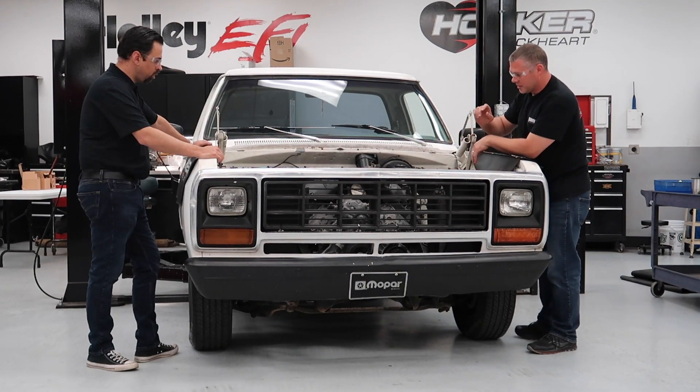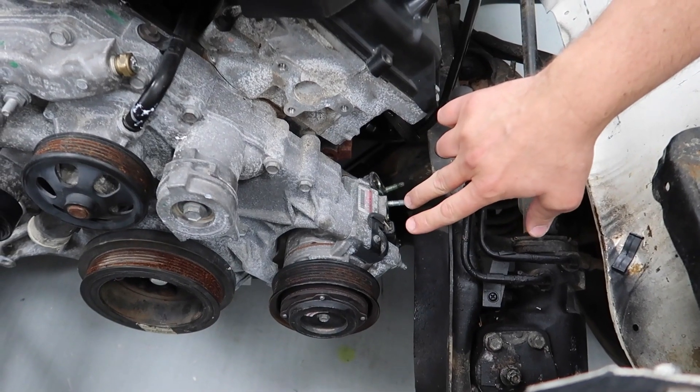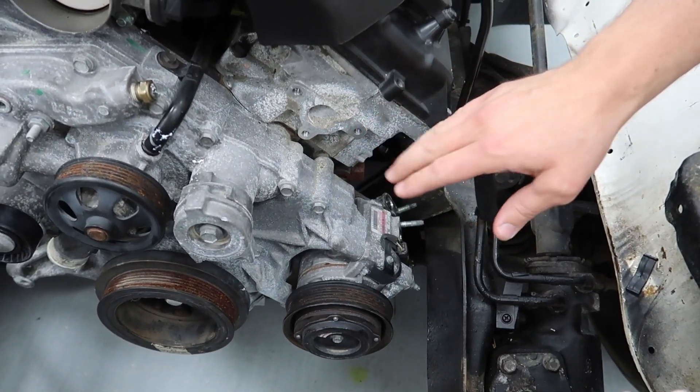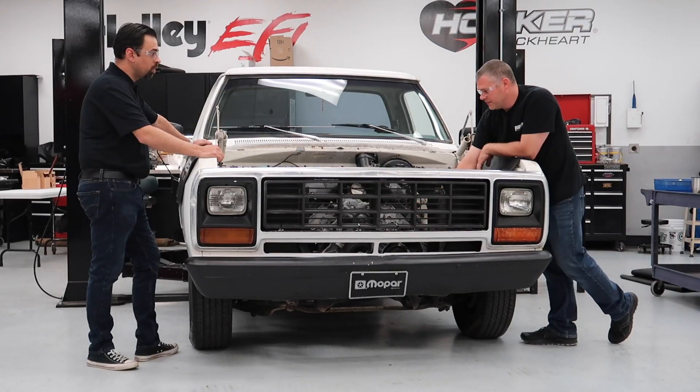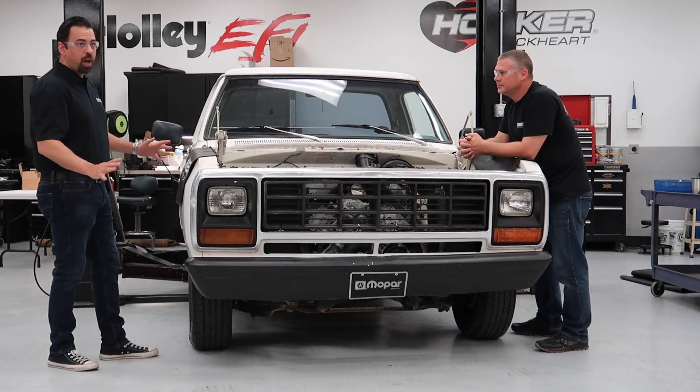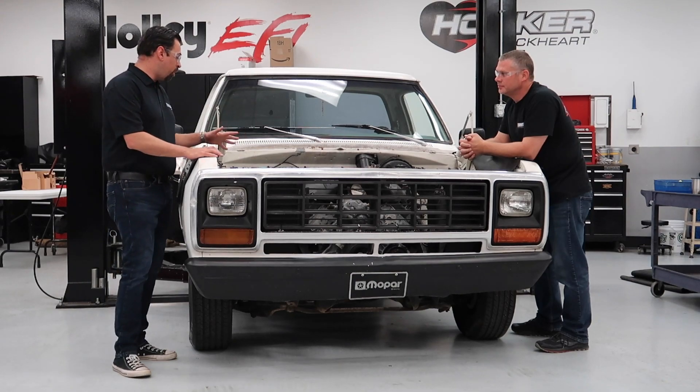We think that's a pretty nice feature. Up front you've got your accessories — your AC compressor will fit without any modifications, as long as it's a VBT motor. Your alternator bracket — we're coming up with a solution for that which will come down the pike a little later. So today we're really talking about the headers, the crossmember, the motor mounts, and the exhaust.